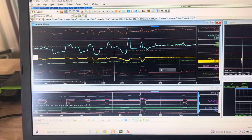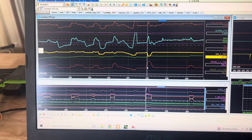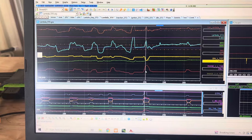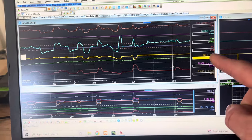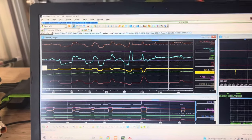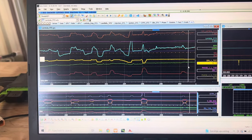Let's show you some part-throttle stuff. Here in the part-throttle area at quarter throttle, we're looking at the air-fuel ratio. Anytime you blip into the throttle you're going to go a little lean — there's no way around that. You'll always have that quick lean blip, but a lot of you guys with air-fuel ratio meters don't see this because your response time and data logging system isn't quick enough. We're doing steady-state testing at low throttle openings, around 14.5% throttle. Picking the air-fuel ratio here is determined by power output, throttle response, mileage targets — whatever you want. We go through all throttle positions and RPMs, edit the map, then retest until we hit our power goals.